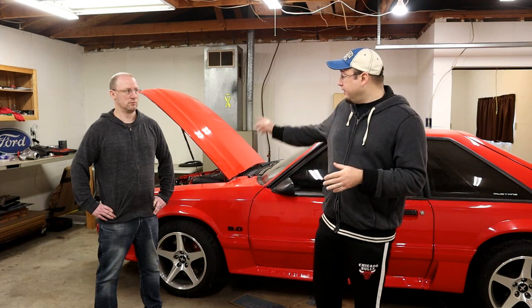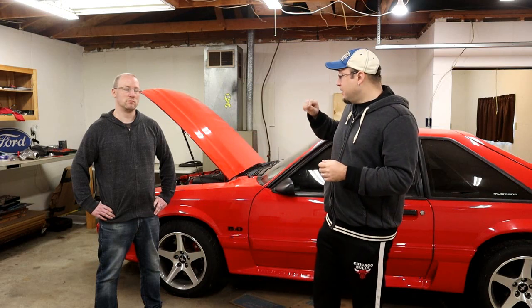This car being a 93, there's going to be a little bit of a difference in regards to the fuel pump relay. In normal Fox bodies at 92/93, that relay is located on the passenger side in the actual engine bay. I'll cover that in a bit of detail. But otherwise, we're going to get down and dirty — drain a little coolant, remove the upper intake, start pulling out all the factory wiring, and get this thing ready for the Terminator X. It's going to be bittersweet to end this project by getting it up and running again.